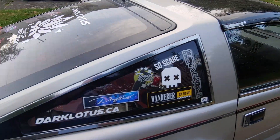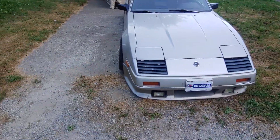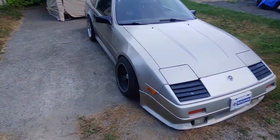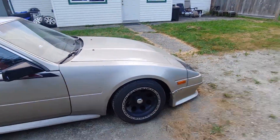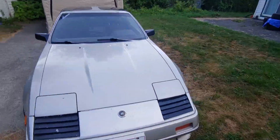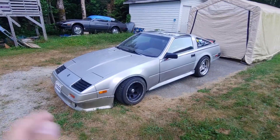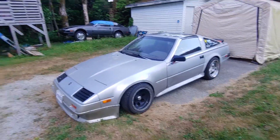Going into it now, I'm just trying to get more seat time and practice. I'm going to take some camber out — I'll probably run minus four. Before I was running minus five. Everything's going to change when I get my caster in there and get a proper alignment, because the string alignment in the driveway — it still drives straight and the wheel's straight, but you know, it's a driveway string alignment. That's it for this episode. I hope you enjoyed it. I'm pretty excited to have my foot back and be able to work on this and drive it properly at the track.